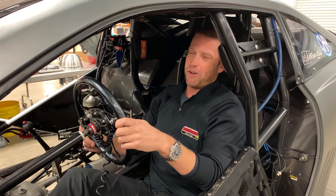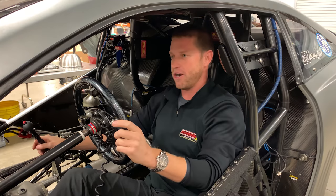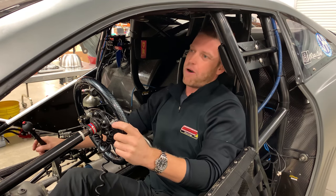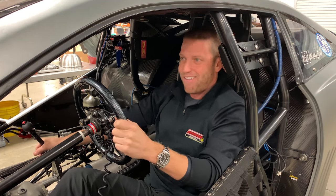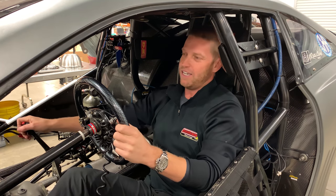We monitor everything on these vehicles. Tire temperature when it leaves the starting line is very critical. I'm aiming for a tire temperature when it leaves the starting line, due to the burnout. You know, that thing, I call it barking it like a seal, but it barks the tires when it stops and you roll out there.